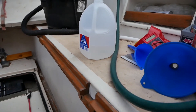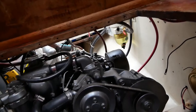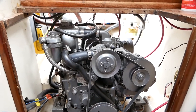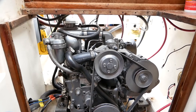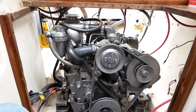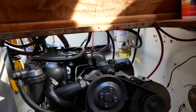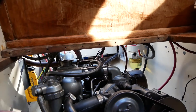In the end I used pretty close to three quarts or three liters of distilled water as coolant on this engine. I'm going to run it up now and monitor temperature along the way to make sure I don't overheat, in case I did miss an airlock somewhere and the fluid did not top off as I was hoping. I'll start the engine after getting my cap back on and I'll be monitoring temperatures.